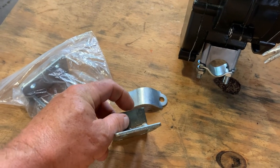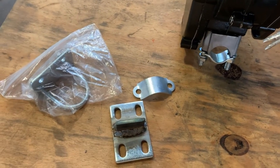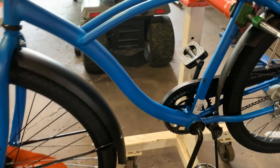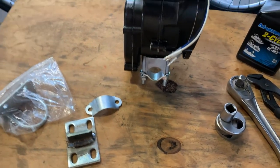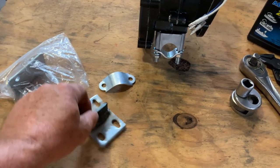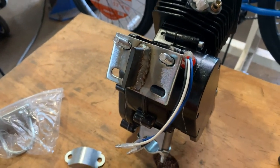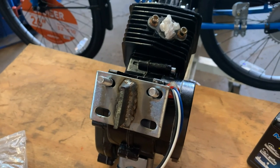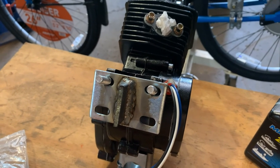The length you'll have to measure because every bike is different — they go from three-quarter inch all the way to an inch, inch and a quarter, depending on the bend of the bottom tube of your frame. Lucky for me on this particular bike I already know the size because I've done a handful of them. I'll position the motor, measure, then set the motor on the frame and see where I need to grind a little paint off the bicycle frame because I want a clean surface to weld to.